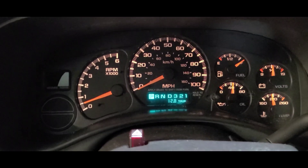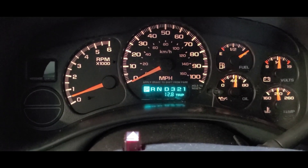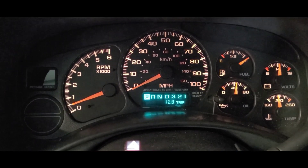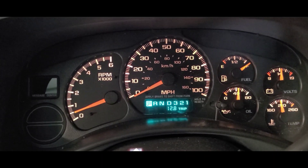I just took it on a little test drive — went 12.8 miles. This light would have definitely come back on by now, so I'm fairly confident that soldering all that up fixed it. I'm very happy this all worked out. It seemed like a fairly simple repair, and very inexpensive. So if you've got a soldering iron and a couple of tiny Torx bits, you can do this yourself.